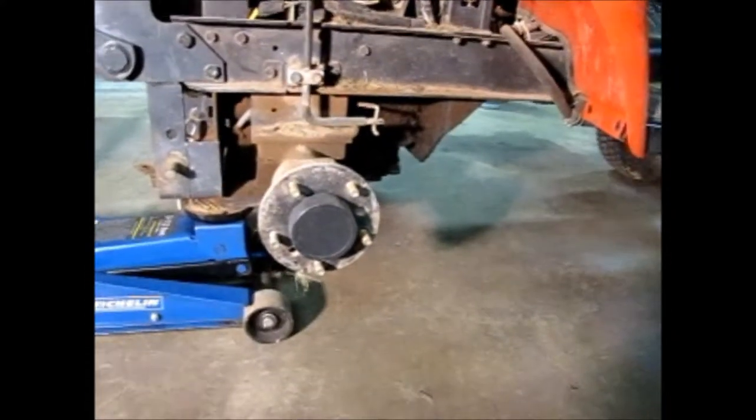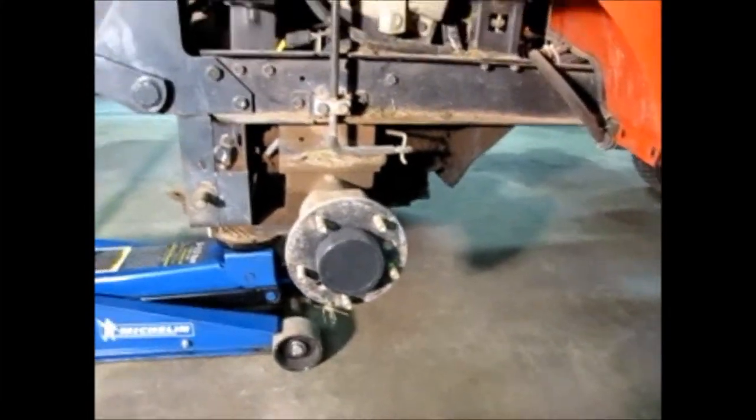What I like to do is take the wheel off on this side just long enough to take the rest of this fender off, and then I'll put the wheel back on. On the front lever, you've got a spring. You take the spring off the top and just bring it down — that takes off some of the tension. Then there's a cotter pin here, you take that cotter pin out, slide your lever forward, grab all your hardware off there and bag it, and then you can lift that right up out of the slot.